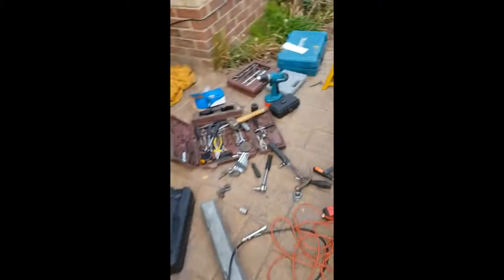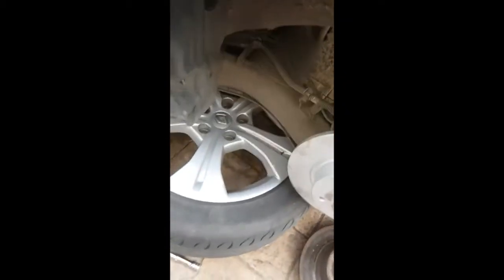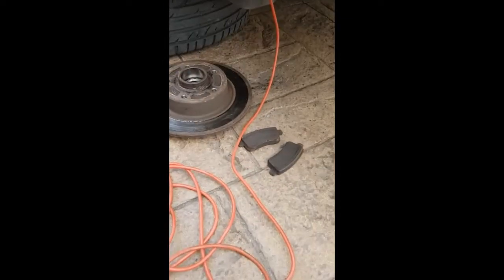Now we need to pump the brake. We've fitted the new disc — a lovely new disc — and brake pad. Now we need to pump the brake to bring it back in again before we do the motor. Let's pump the brake a bit. There we go, so that should now move the caliper in. Now we need to advance the motor. So remember, to put the brake on we put the blue here — we're going to put it on the handbrake.